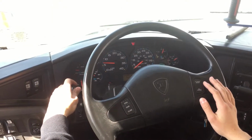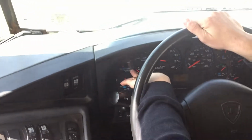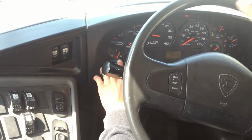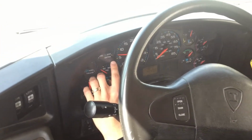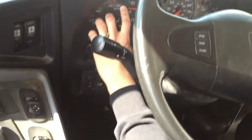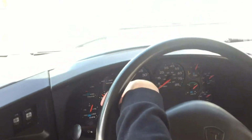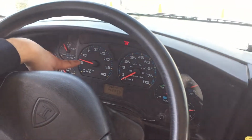Okay. So now we got our gauges. The transmission gauge, it's around 150. It's working properly. The amps gauge is between 0 and 75. It's working properly. Our water level, it's between 170 and 200. It's working properly. Our oil level is at 30 psi, working properly. Our RPM gauge is probably working properly. We're not moving, so it's a 5.